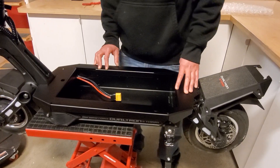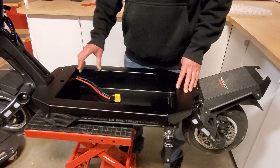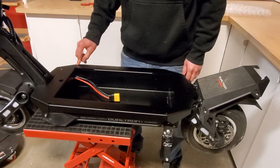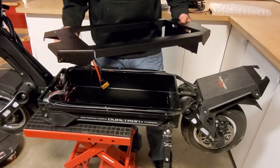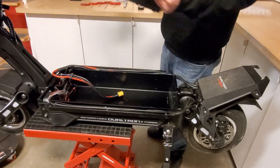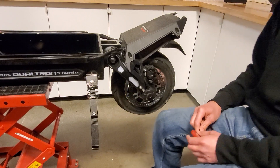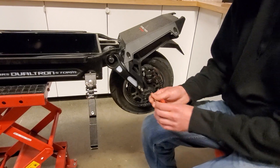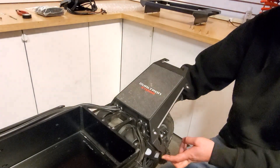I already have a head start. I took the battery out of the compartment and took the screws out of the perimeter of the deck — those are the four millimeter Allen tool. That allows you to lift that up, then you can slide the battery cable out of the side and set that aside. The first screws you want to hit are the kicktail bracket mounting screws on either side, using the four millimeter Allen tool.